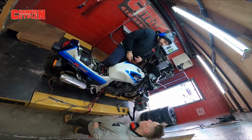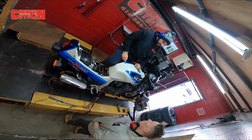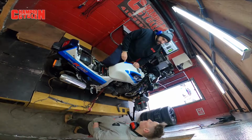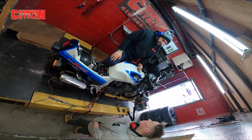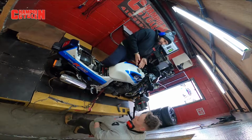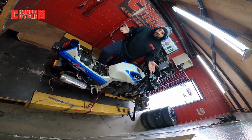So let's say the pilot jet is too rich, but the main jet is bang on. You'll come back from a test ride and those plugs will be black. And you're gonna think, oh, the bike is rich. But in reality, it's not. It's just the pilot. But it's riched out the plugs, so you won't know.